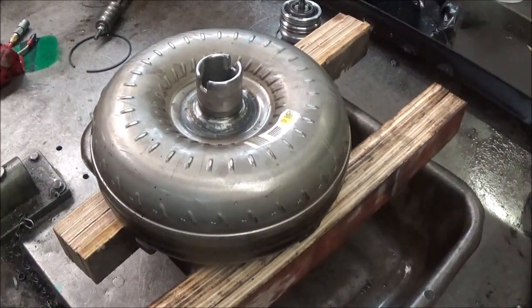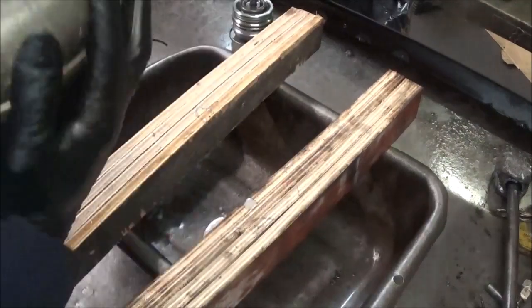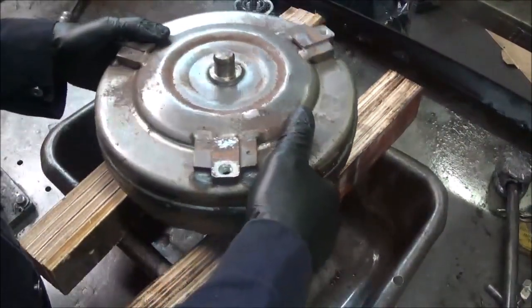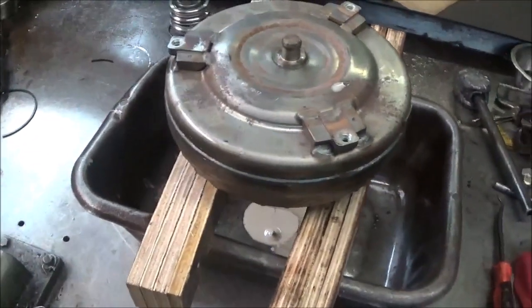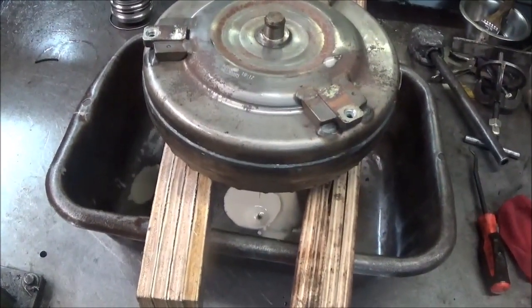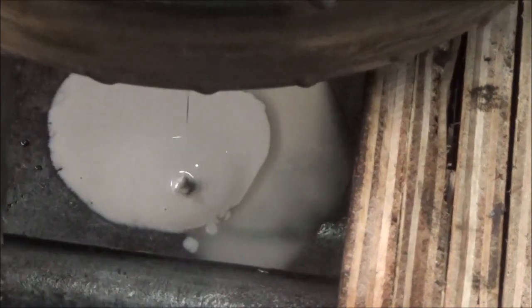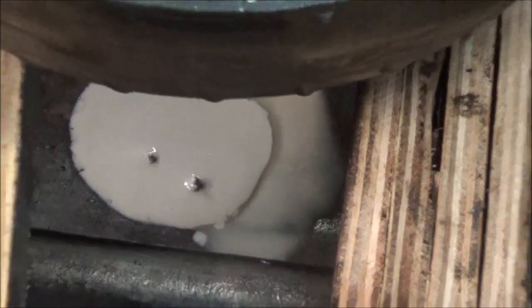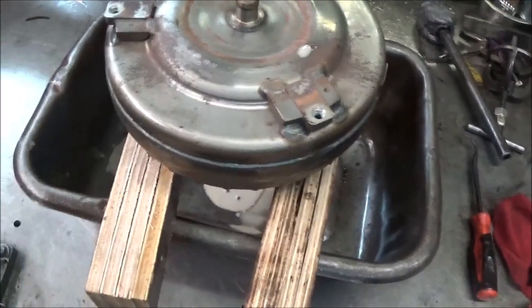Now in this case, once again, it had antifreeze mixing into it. Different color because of different color transmission. But flip it around, and I'll let you see what is happening there. See it dripping out? And that's like mud, beige, because the fluid is different. So it's not pink milkshake like those that got red transmission fluid. Okay. Now this is very, very thick.